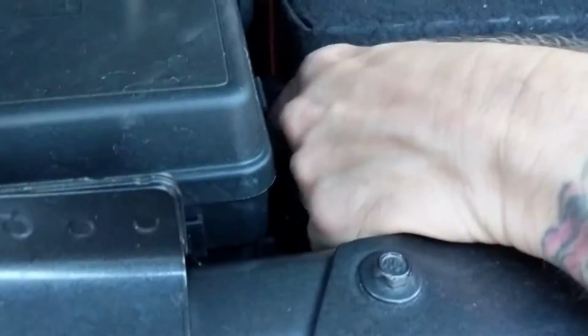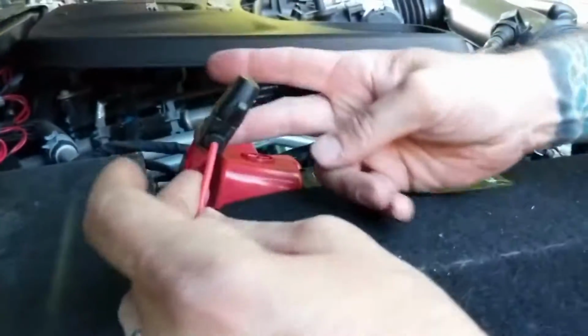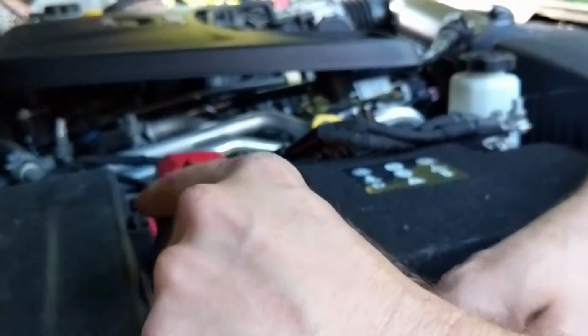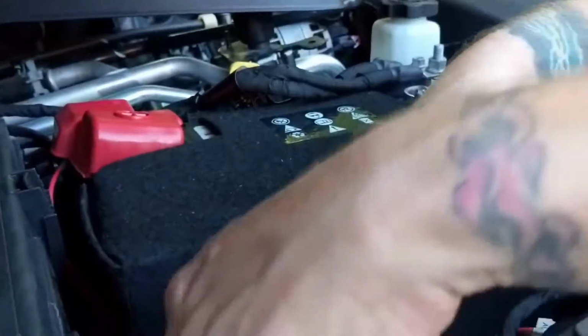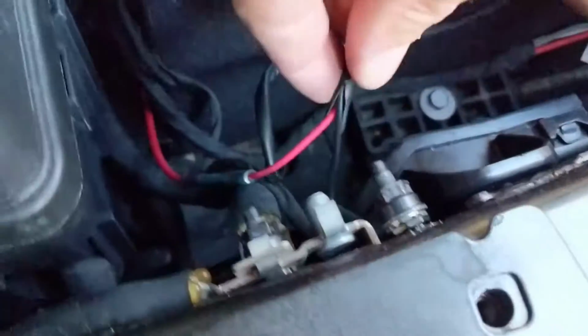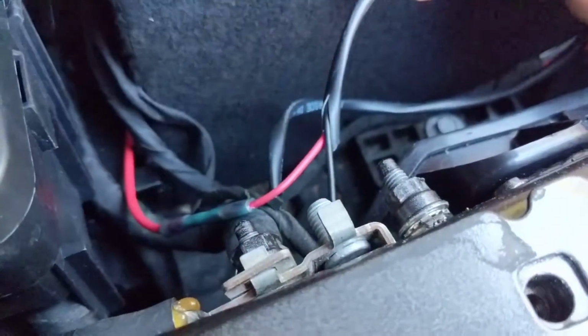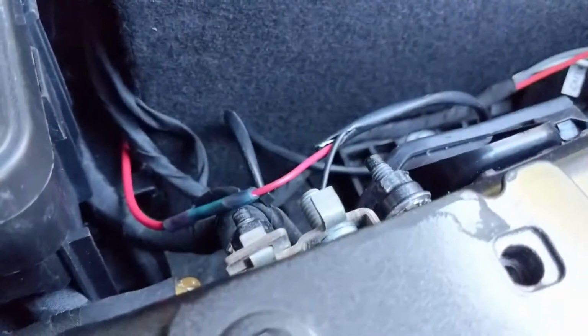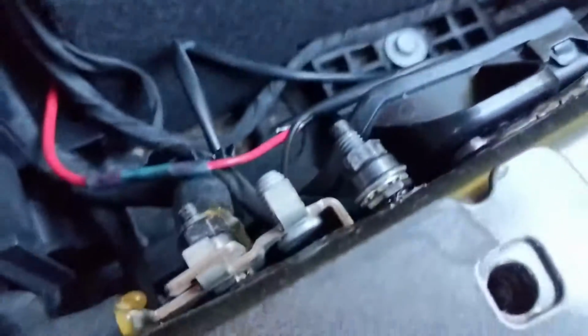I've got my 10 amp inline fuse here, so I've got my power going straight to the battery. And then I'm using one of these chassis ground points over here. These Gladiators have multiple points for grounding, and the battery is grounded directly to the chassis here. So you can either go straight to the negative lead of the battery or just ground it right to the grounding posts here. It made for a cleaner install to attach the ground there and attach the positive to the battery. It's all tucked down in there so you don't have too many wires on top of the battery.